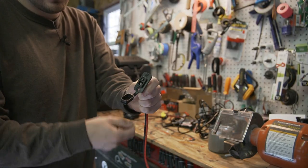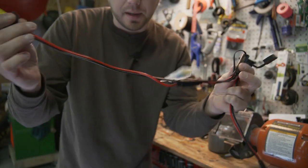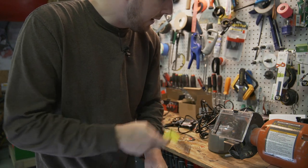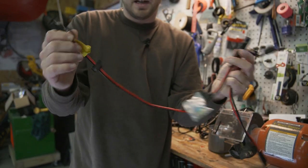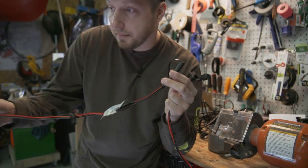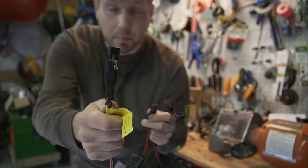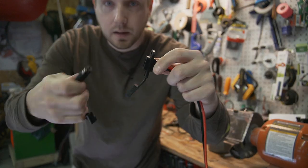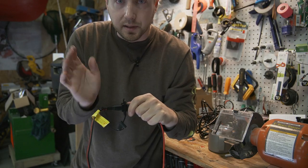The wiring harness is way too long to shove in the box, so I'll chop it up and make it neat. I'm going to mount this power plug to the box. There's a little jumper with a fuse here, though I probably don't need that one since the wiring harness already has a fuse. I'll plug this right into my battery tender cord or the rear heated grips port — it's the same plug. The switch will turn the power on and off.